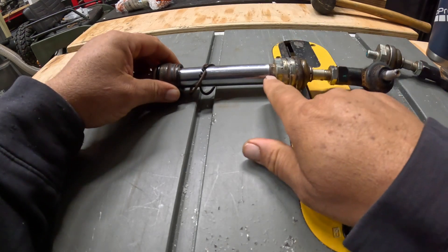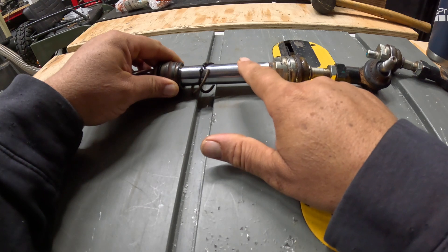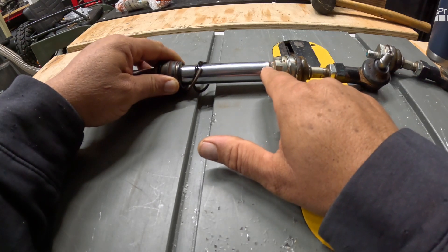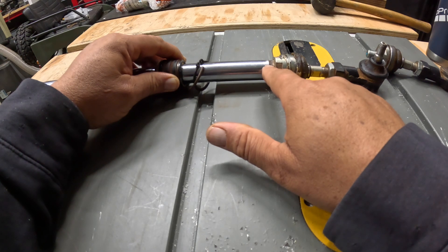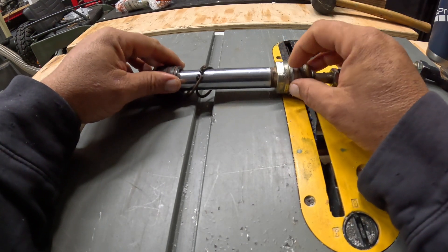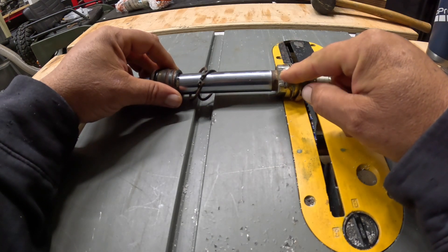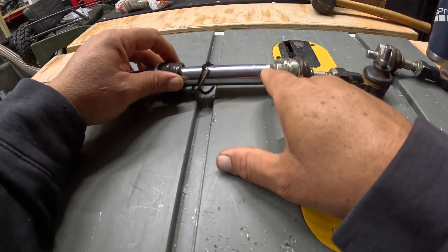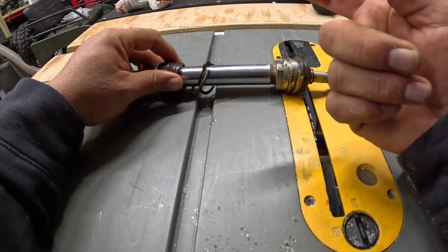My son and I tried to get this off. Keep in mind there are only two flat spots here, and this is only on this side, so you can separate the piston rod from the tie rod end. The flat spots are four and a half millimeters wide — not very wide at all. The ones up here have four flats and are probably eight to nine millimeters wide. My son and I tried to remove this from the piston rod and had no luck — the biggest issue is that the wrenches we had were not strong enough and kept warping or spinning without locking onto the rod.